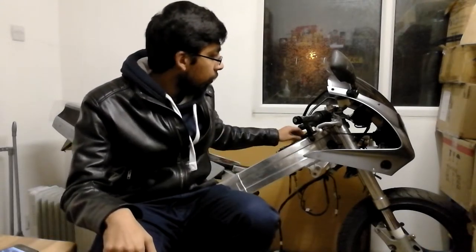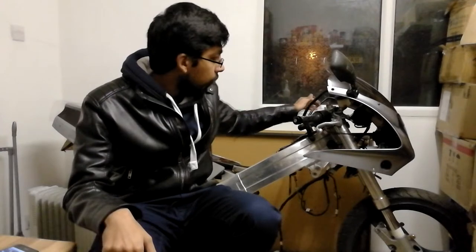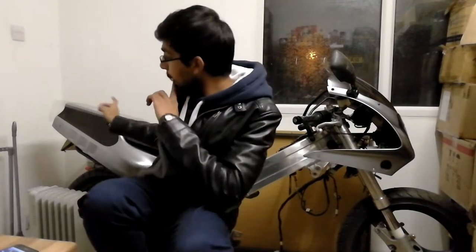Because I was going with the VJ21 loom I had to adapt some things. The tail light uses a different connector on the VJ22 than the VJ21, so I created a little sub-loom that bridges from one connector to the other. I don't like making permanent alterations to a wiring loom — that's a bodge. Having an adapter means that if I ever revert back to a VJ22 loom and engine in the future, it'll just unplug cleanly.